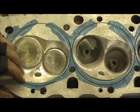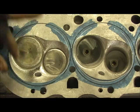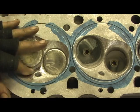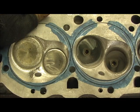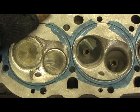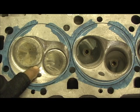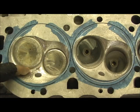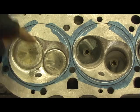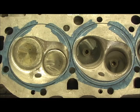I was able to do a pretty serious chamber mod. I'm going to put a 2350 valve in and a 2300 and see how much seat I've got on the edge. That's how you judge whether or not you can put a larger diameter valve — how much seat you've got and how much you have to thin out during the valve job, because you can't lose your crush that keeps the seat inside the head. If it was a cast iron head, I wouldn't sweat it — it'd automatically get a 2350 — but on aluminum heads with a hardened seat, it's got its limiting factors.